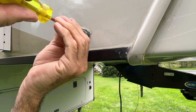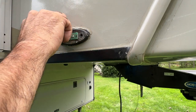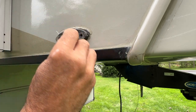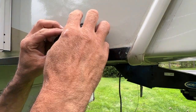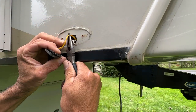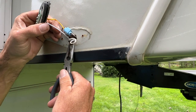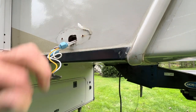Some of these screws will be all rusted — you'll have to put bigger ones in. If you want to replace the bolts, I'd go with a number 10, about one inch long; these are number eights, one inch long. The new lens doesn't come with the gasket, so we're going to save it. I'm pulling one wire at a time — there's connector one, and connector two.